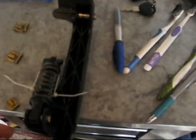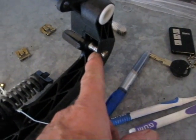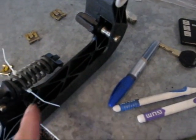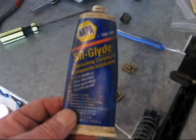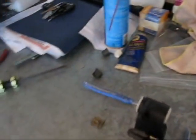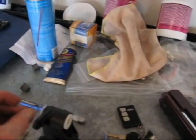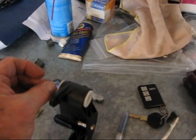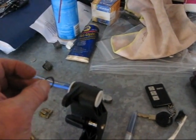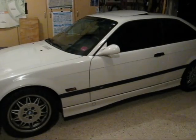Everything is back together now. I left the three clips off — we've got lubrication in here, lubrication on the pin which goes to the clutch master cylinder, spring is compressed, lubrication there, three clips ready to go. By the way, I used some silicone that I had — it's good for 20 below zero up to 600°F, so this ought to work pretty good. Also, UUC gives you some washers — some thin steel washers — to really tighten up the tolerances. I put one on the pin that's in the car and I've got one more to go if I need it. I want this pedal to be nice and tight, not heavy going down, but tight so there's no slop in it.